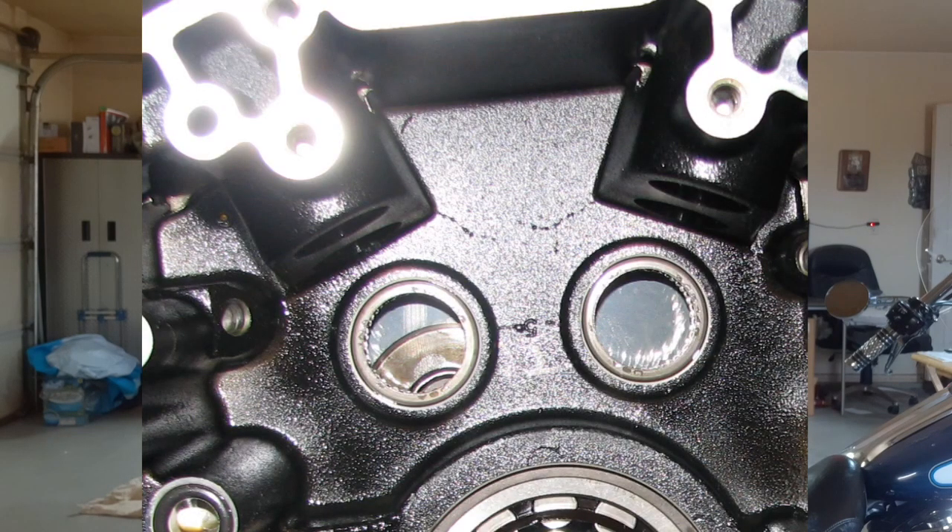By the time you spent all the money, you can go out and get a new cam plate. Now, having the cam bearing serviceable is always a good idea, but those outer bearings — the roller bearing and the ball bearing — I never saw them go bad ever. I've heard that they've gone bad, but I have never seen one myself. The bearings I have seen go bad are the needle bearings that are pressed into the case — those I've seen a number of times. In fact, I rebuilt two motors where the needle bearings went bad.